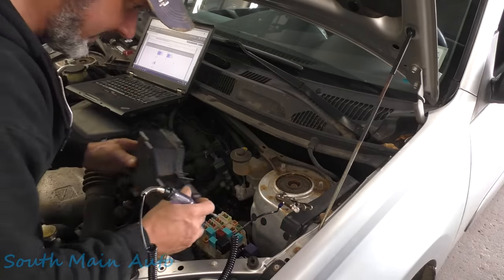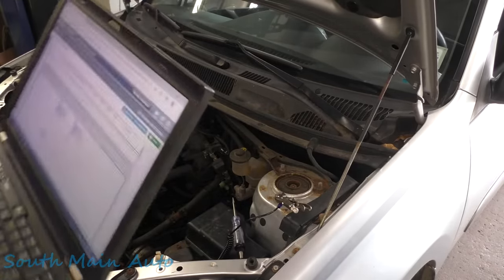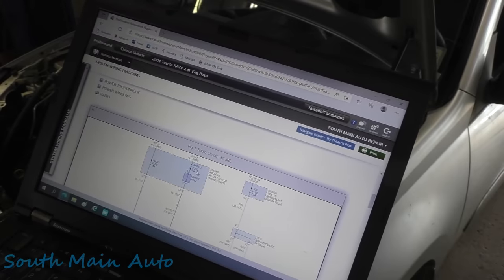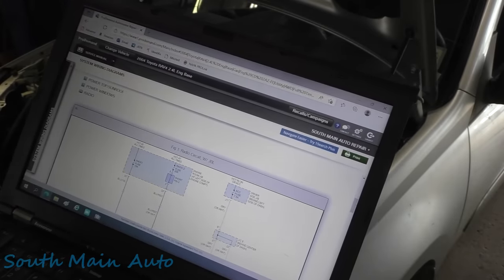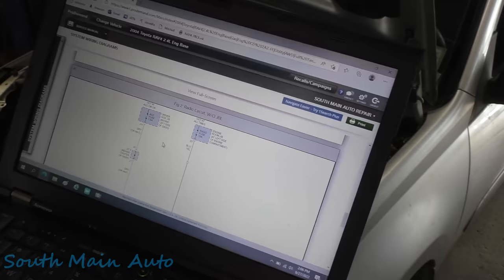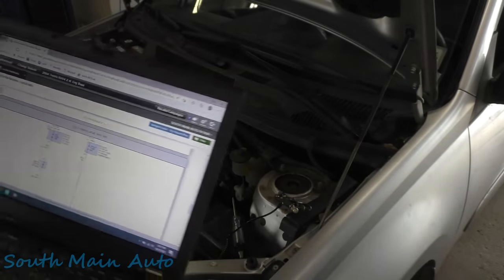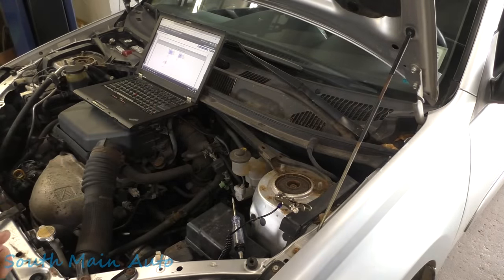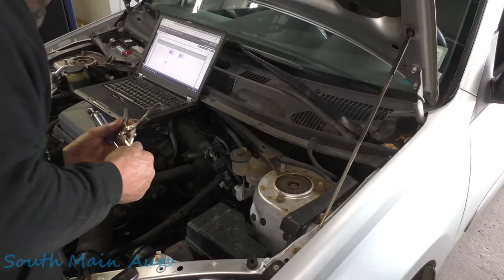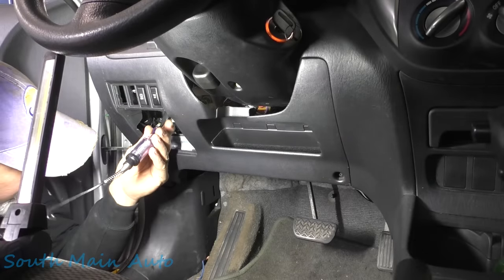That's pretty interesting — perhaps that is the keep-alive side of things. There is another fuse here that runs the radio. Let me check — radio 2 fuse, 30 amp; radio fuse, 15 amp. I need to double-check which one it's supposed to be. Then here — driver side junction box, left side of dash — accessory fuse, seven and a half amp, hot in the on position. So let's check that, because if that's the case we might just be dealing with a bad ignition switch. ACC fuse, seven and a half — let's see, it should be this middle one.